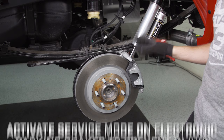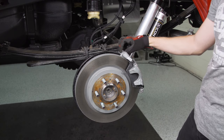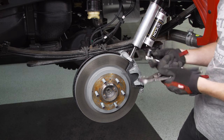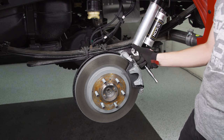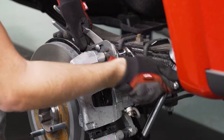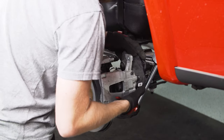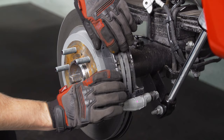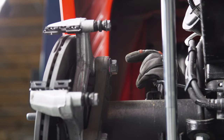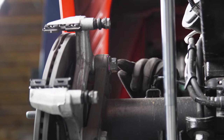With all this tied up, let's move to the back. Doing the rear brakes isn't going to be much different from the front. We're going to start with these two bolts on the back of the caliper — they're half-inch — but there is a nut attached on this side and I don't have wrenches skinny enough to fit it, so we're going to use channel locks to hold that outer edge. For the caliper bracket, there are bigger bolts on the back that are 15/16, so if your truck's older and more rusted you might need a cheater bar, but we'll get it with a breaker bar.